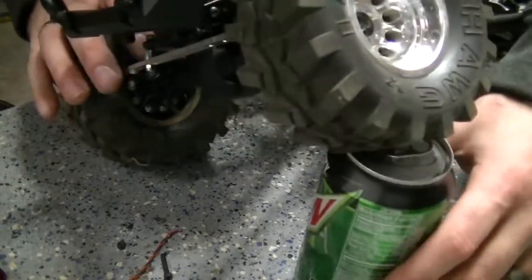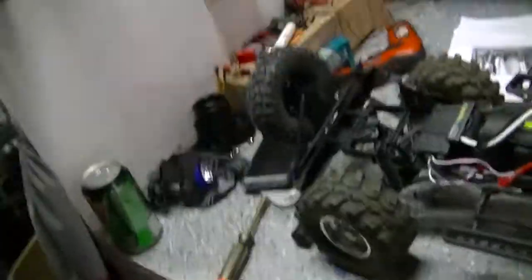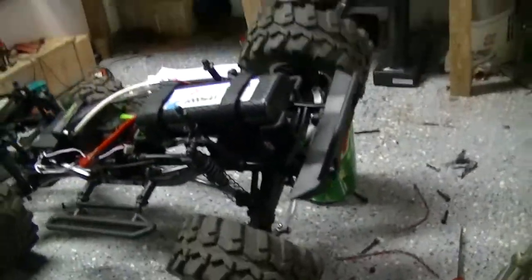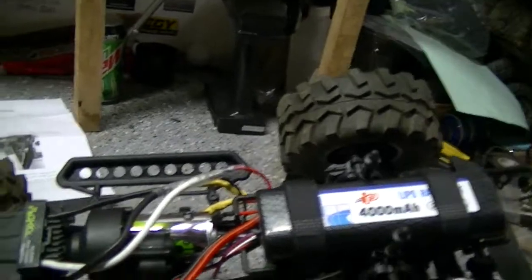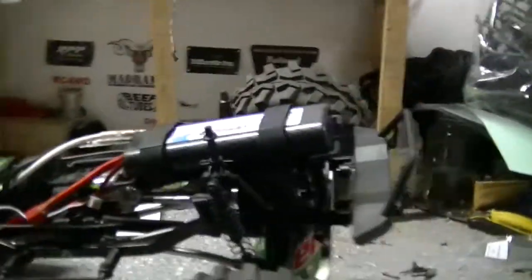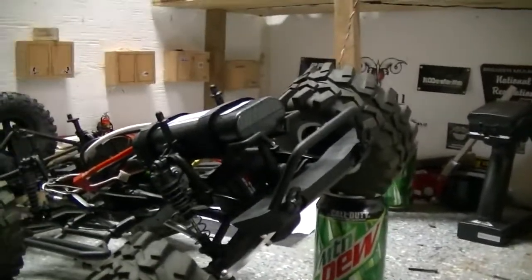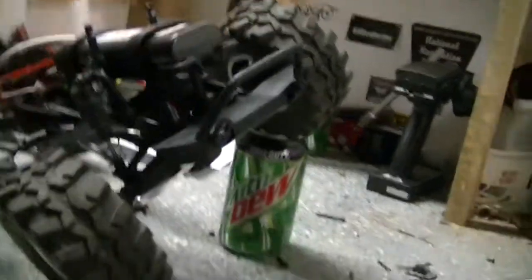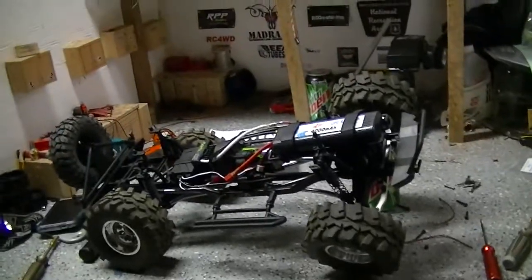By doing the three-link relocation, you guys, I'm probably gonna have to pick you up for this, so pardon the shaky video. Now you can see that this Jeep, using four-link front and rear and the White Knuckle RC four-link kits, high clearance, now has a full Mountain Dew can's worth of flex, which is very impressive considering it's all stock minus the links. Gears, shocks, all stock. So there you go, guys. There's the real quick addition to the third week build.